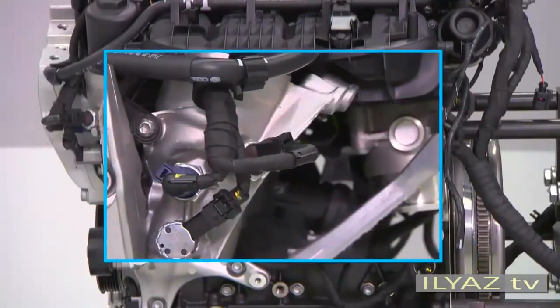In addition, a control valve for the piston cooling nozzles is now located at the front edge of the carrier. The valve controls cooling of the piston crown by switching the nozzles on and off.